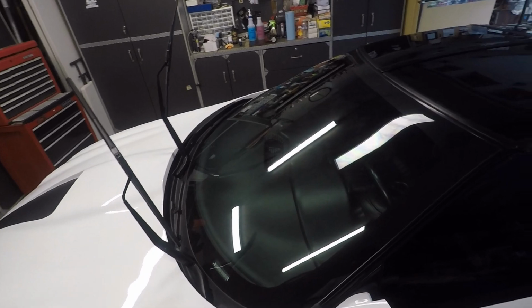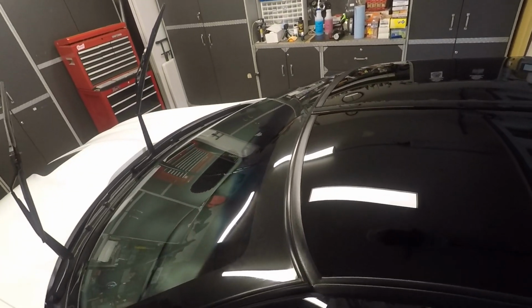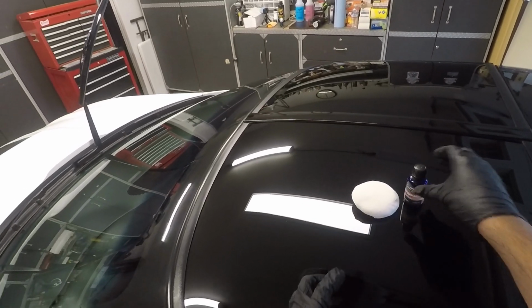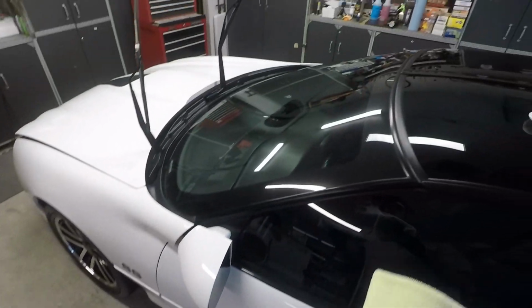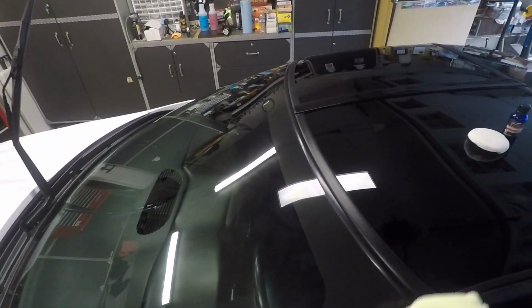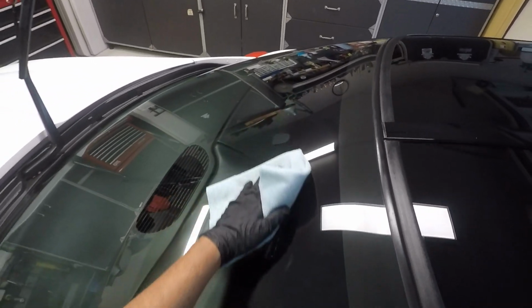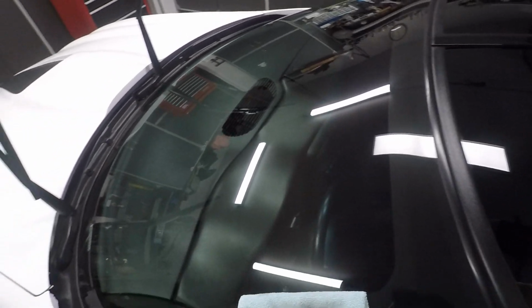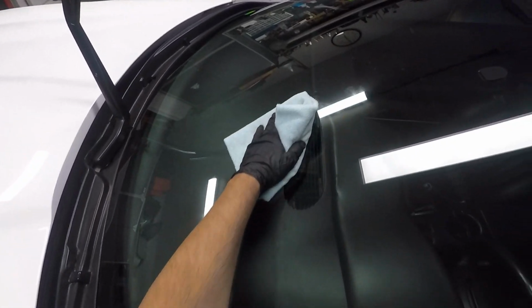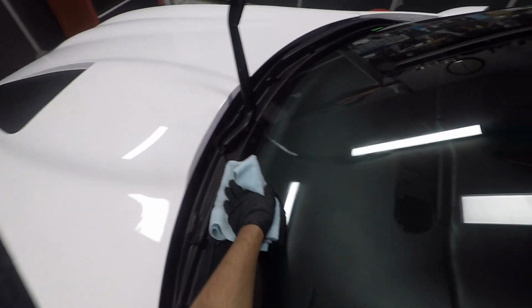I'm going to let it sit for just a few more seconds as the bands open up a little bit more before I completely level it out. And so while that's doing that, I'm going to put this down here. Not going to scratch or anything. I'm just going to set it aside. Get my towels here. Again, these are repurposed towels that I've used for coatings. And so then what I'm going to do is take this towel, the first towel, and level out the product. Again, you're not removing it at this point. You're leveling it out. You're essentially removing the carrier solvents.